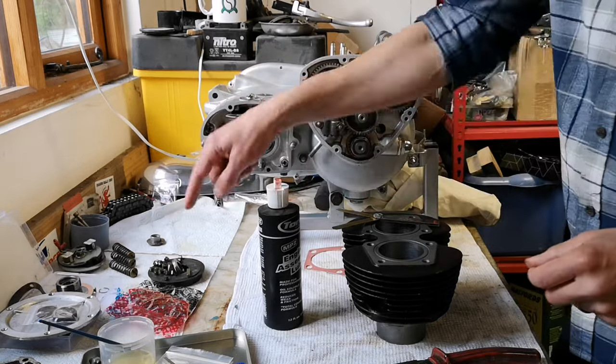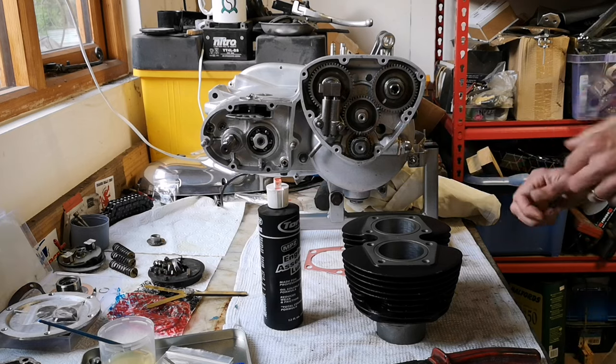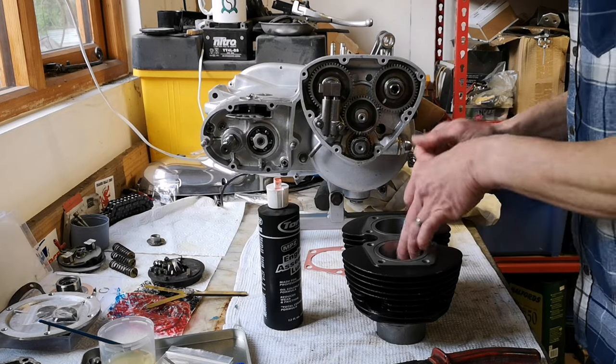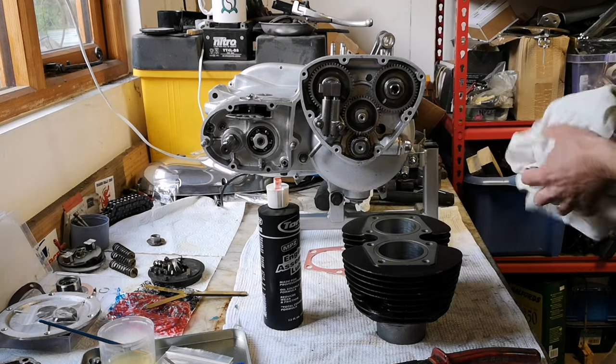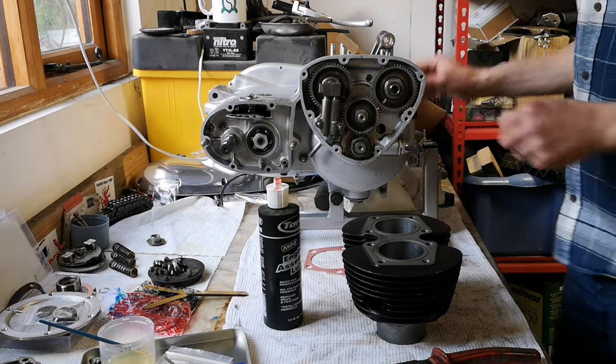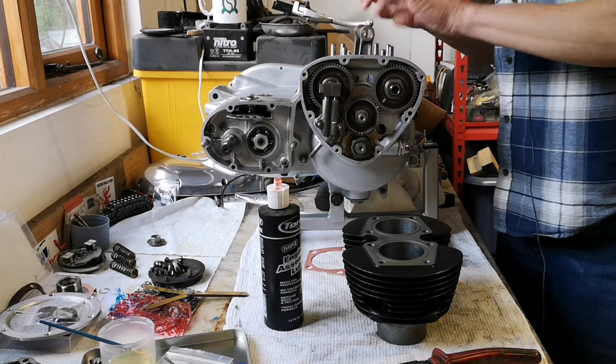So, I did all those the other day. That's why my feeler gauge is out. So, I don't need to do that. Just wanted to show you. So, gap piston rings. Next job is put the pistons on. So, got the conrods. Need to put the pistons on there.